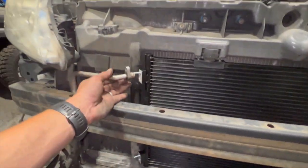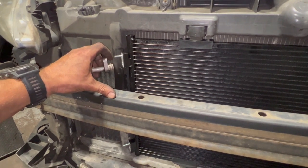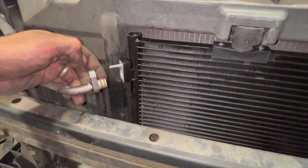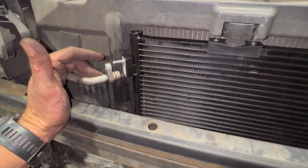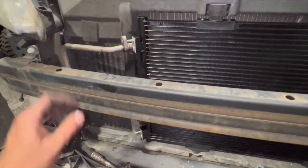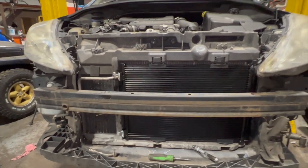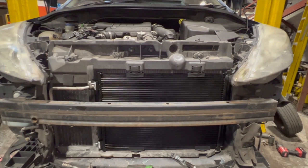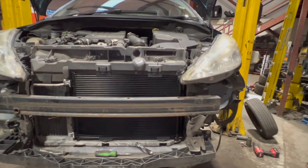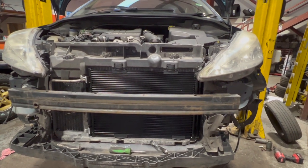Now it's built back and clipped in, I'm refitting the pipes — I've swapped the studs over as the new condenser came with new studs. The kit did come with a couple of seals but they weren't the right ones — this has a double seal and luckily they don't look in too bad condition. It's ideal to swap them at this stage if you can. The top pipe is still okay and I've used one of the new seals on the outer edge. I'm not optimistic about the bottom pipe — we'll likely need to replace it — but I'll have a go. That's the basic replacement of the aircon condenser, now rebuilding exactly as we took it apart.